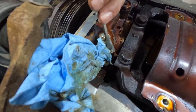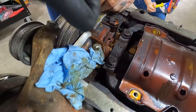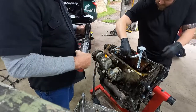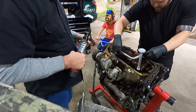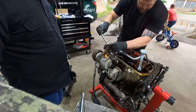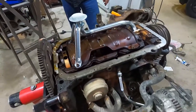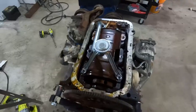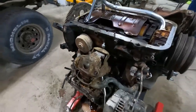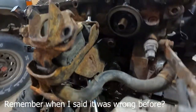Got a little bit of leftover gasket from the pickup — trying to make sure we get it all without getting any debris in the motor. Every time you touch it, it just crumbles, so might need to get a set of needle nose pliers. Those back two bolts on the pan actually go through the rear main housing, so keep that in mind. Also, as a small reminder, the dipstick itself feeds through the motor mount, so you want to make sure you do that all at the same time.